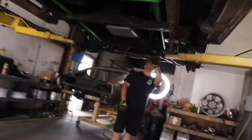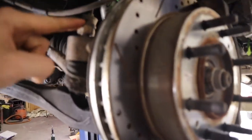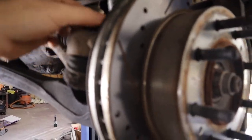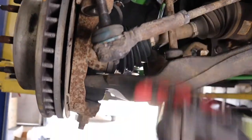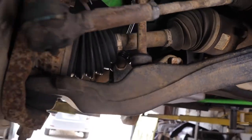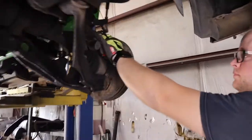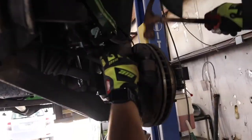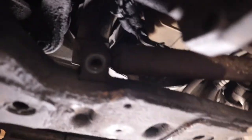With that said, here's where we're at now. We have the wheels removed and we're going to start with the tie rods. You need a 21mm socket to take this off — we've already loosened it. We knocked it out with a hammer and we're going to do the same thing on the other side. Hopefully this goes smooth; this is about a 12 to 13 year old truck.